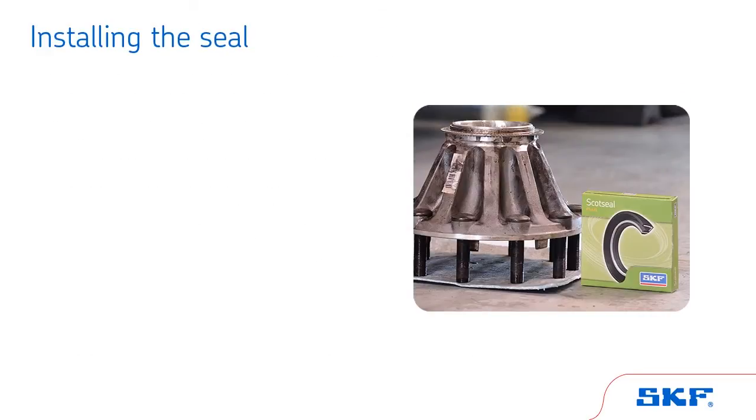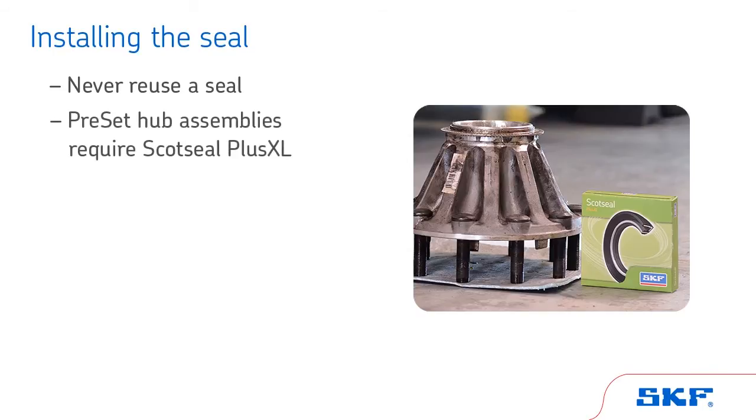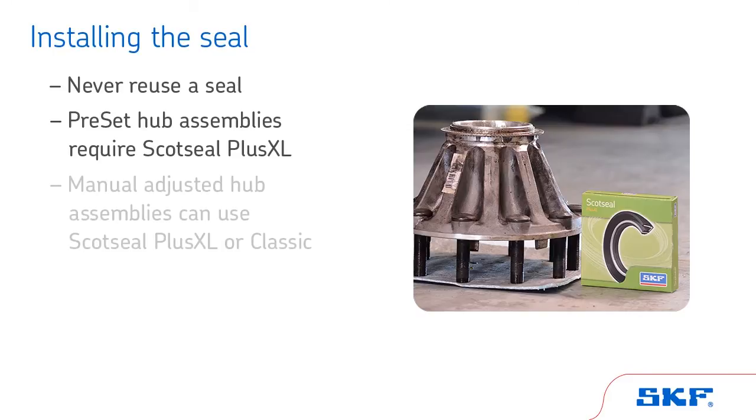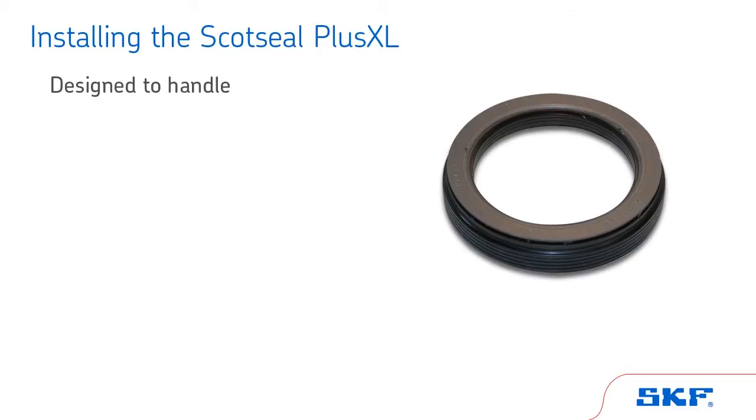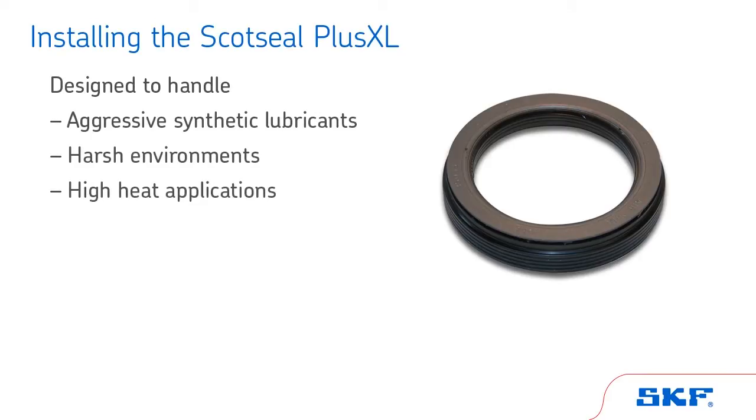Now that the inner bearing is in place, it's time to install the seal. Never reuse a seal that has been installed on a spindle or removed from the hub. The sealing surfaces have been compromised. Preset hub assemblies require the ScotSeal Plus XL, the OEM seal in preset hubs. However, the ScotSeal Classic or ScotSeal Plus XL may be used in manual adjusted hub assemblies based on your preference. The ScotSeal Plus XL is designed to handle aggressive synthetic lubricants, harsh environments, and high heat applications.